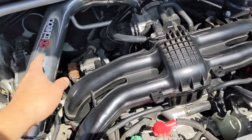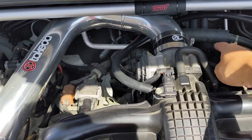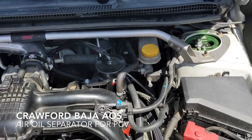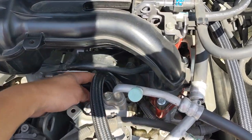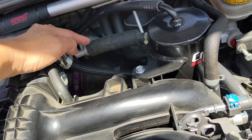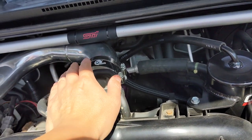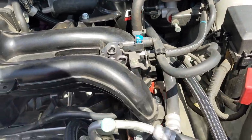The one caveat of this is that it would be louder than the stock unit, but the stock unit also had a baffle catch can that connected to the breather valve — that's the Crawford Baja edition. So usually this line here, the breather valve would be going straight underneath this intake and then to a tube connected to your intake baffle on the stock OEM box up here in the tube. But now that I have an aftermarket intake, it's very easy for blow-by to happen that goes through this breather line.